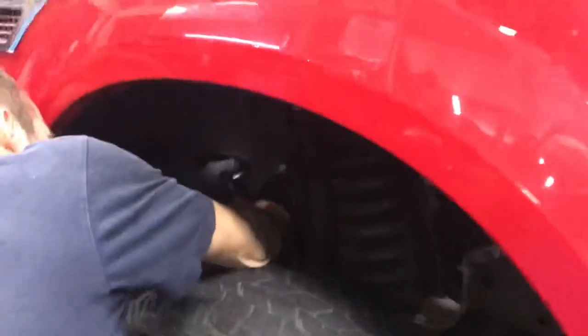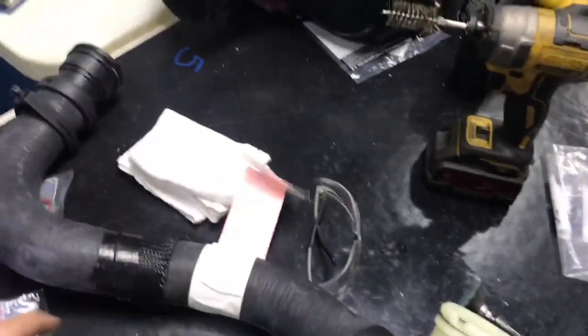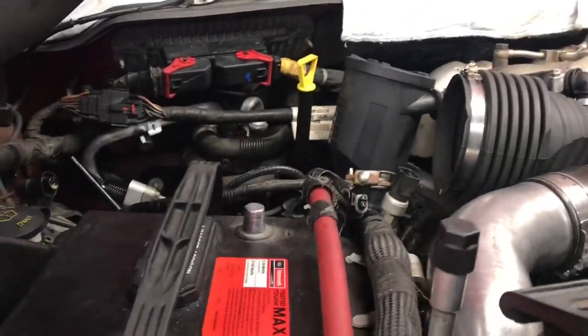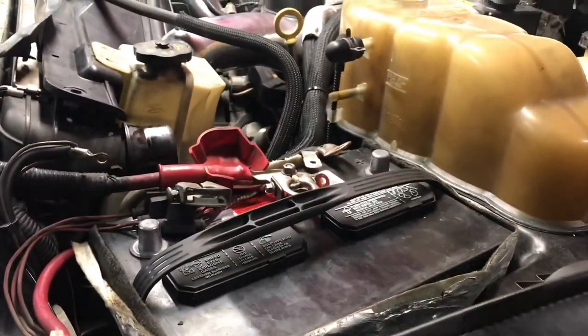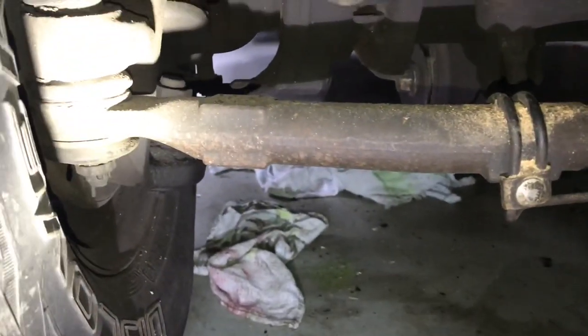It's usually a pretty good time when the fender well is going back on. We got the new lower radiator hose for the driver's side. We're waiting for more terminal spray to get the batteries all done. Quick update — this tie rod is going to cause us to need an alignment. This one just straightens the steering wheel, but this one down here — when you get the threads in it — that's the actual toe-in/toe-out of the front axle, so now we gotta replace this bottom one.